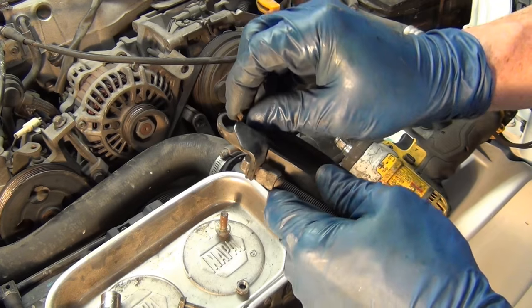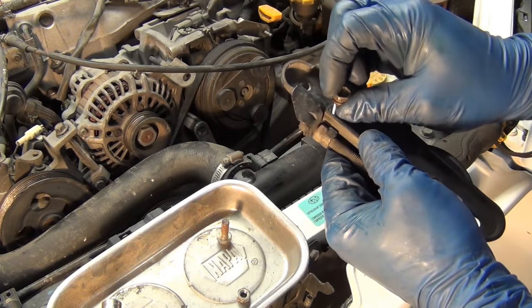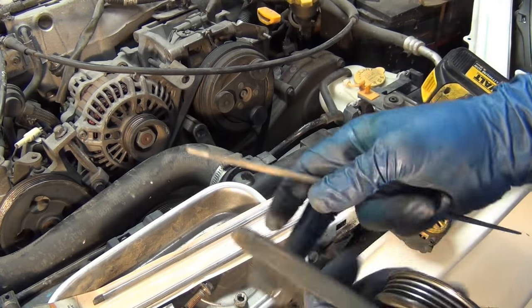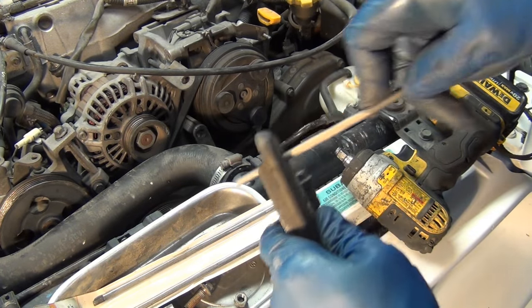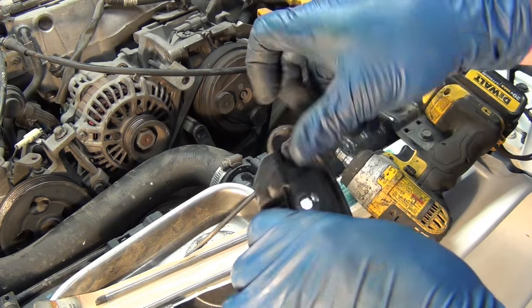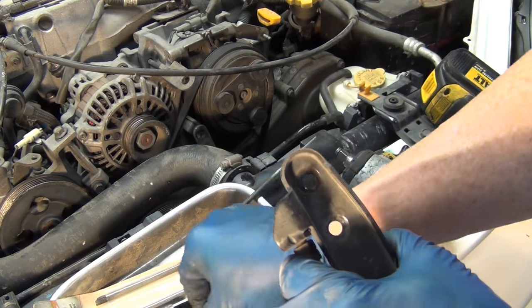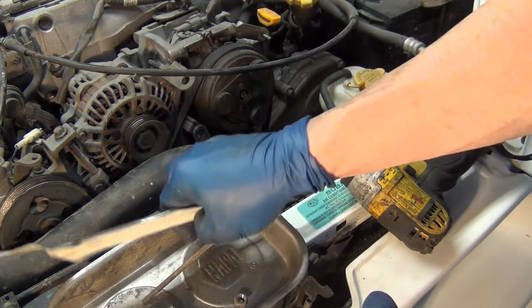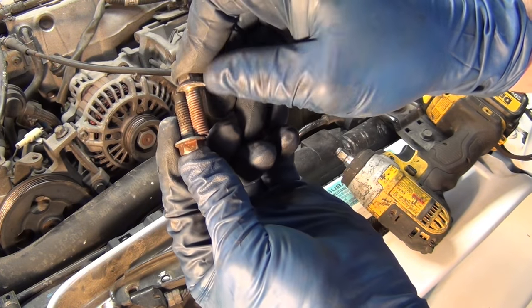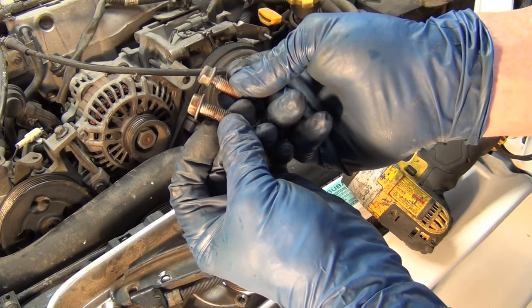I welded a little button on the old stub to push it out, put it in the vise and hit it with a chisel — just took a few hits. I'm going to check my bolt and make sure it fits. I'll hit that with a chainsaw file to open it up a little bit — it's a nice round file you can use to ream out a bolt hole. Remember how it had such hangups before? Now it's clean and nice. You don't have to mess up all the threads going into the soft metal of the bracket. This is not an exact match, but you have enough bolt in there to get the job done. The length and pitch are good, plus it has a built-in washer to spread the force out evenly.